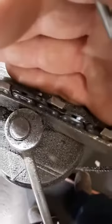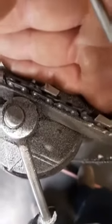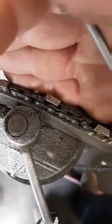And what I do first thing, Mr. Nate, is, you know, this is the angle of the tooth. I'll come this way, almost flat, and I'll cut all that off until my tooth is like a square. And this is me, Nate, not everybody else. You see that? That tooth is almost square. That right there, and that's how I've done this whole chain. Now I got a blank canvas to work with because it's blunt.